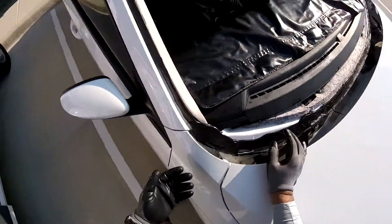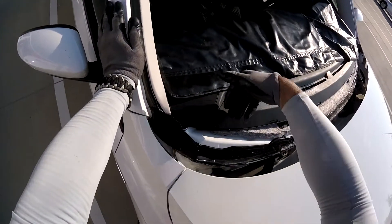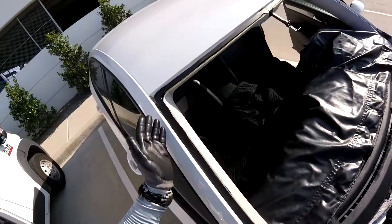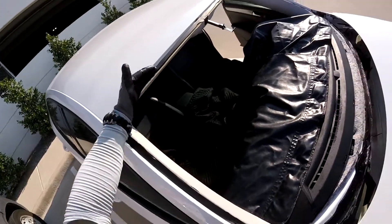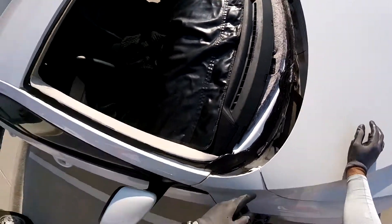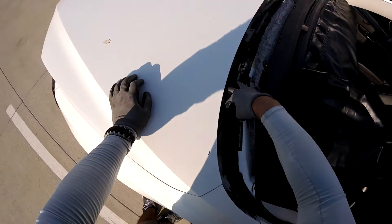Look at this — look at this job. It's almost two and a half to three inches of glue in this area. That's why every time I put my blade in here it couldn't go through. Now, if I use my extractor — even with the long blade — it would go through, but imagine these guys already made a mess here. I don't want to create another problem with the dashboard. That's why I chose not to use the extractor. I just used my blade and wire for small sections, and I used my big custom long blade to go through. You can see he filled all the bottom completely with glue — I've never seen a Jetta with this kind of glue. This is typical for F-150s from 2007-2009, but never like this.